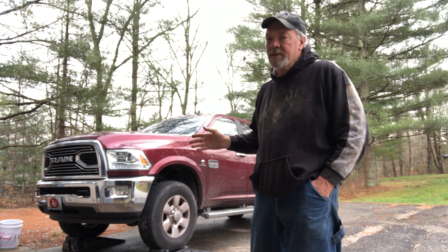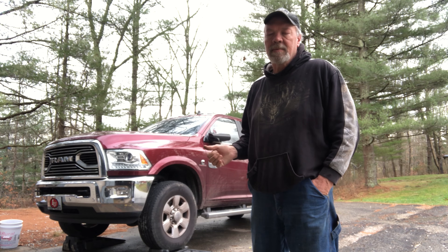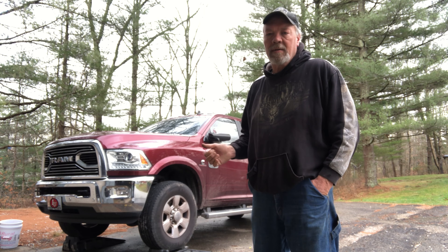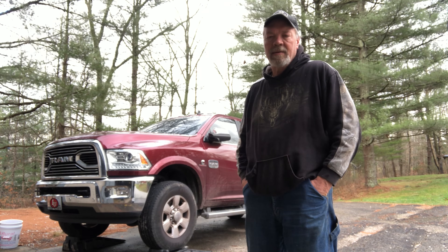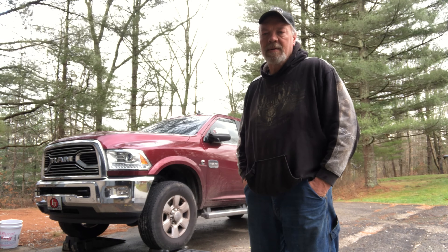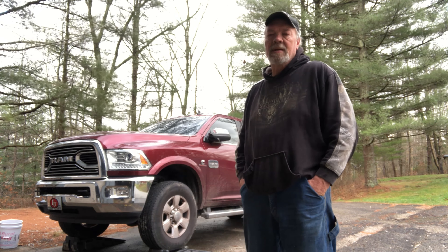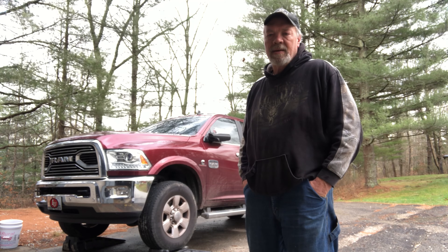Hello from Peterson's Farm of Nashville, this is Phil speaking. I'm going to explain to you, and hopefully save you a lot of money, if you too have the engine light come on and warn you that you have 150 miles until you hit the 5-mile-an-hour limit zone — the death mode, I call it. I ran a scanner on it, and P20B9 was the code — it states it's a reductant heater control circuit open, a generic code. This is on my Ram 2500 2018 6.7 diesel Cummins.